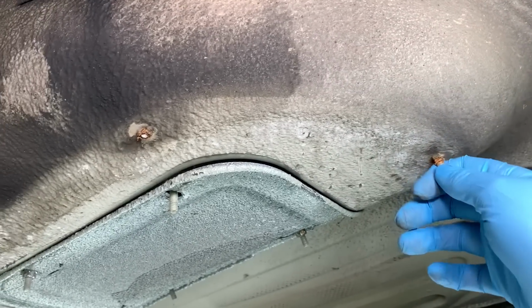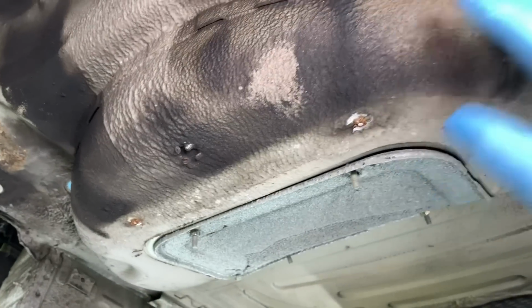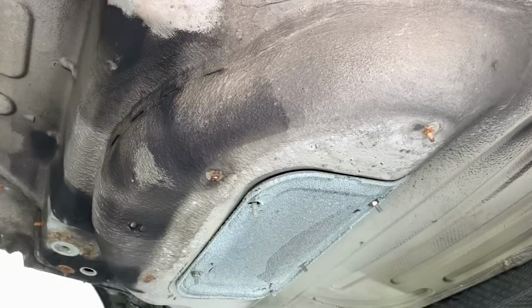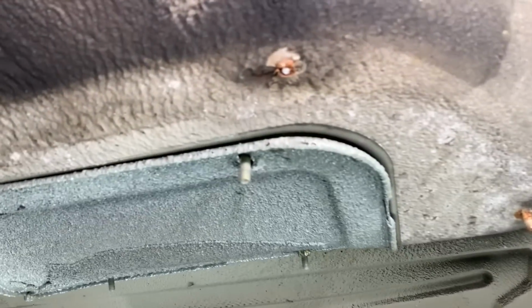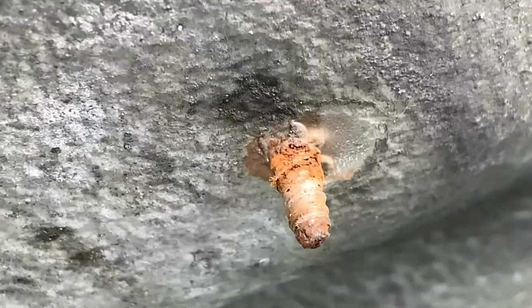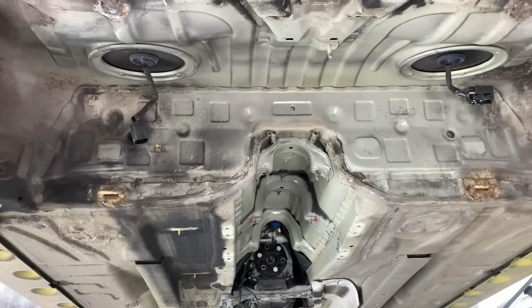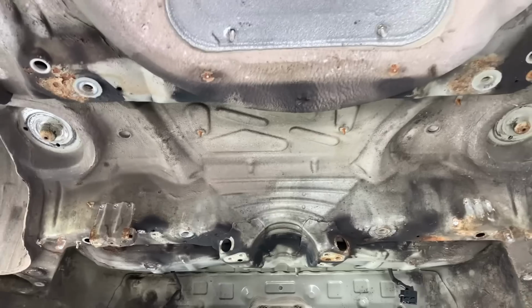Studs for the boot floor brackets, there are three of them along this side. This is the curvature of the boot floor, and those studs hold a cover for the carbon canister, which is a fuel neutralising piece, and that one snapped due to corrosion. So did that one. That one survived, but the thread doesn't look that coarse anymore, so that one might need to be replaced as well. And that's just the rear end of the vehicle. We're not really yet discovering the centre, undersides, or even the front. So we've got plenty of work cut out over the next few weeks.